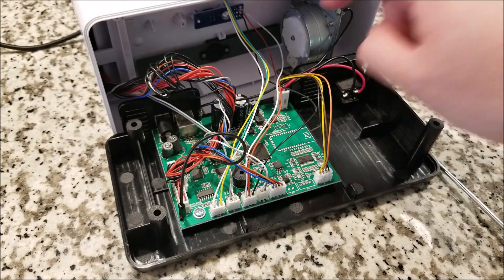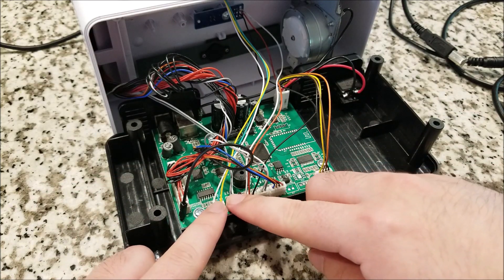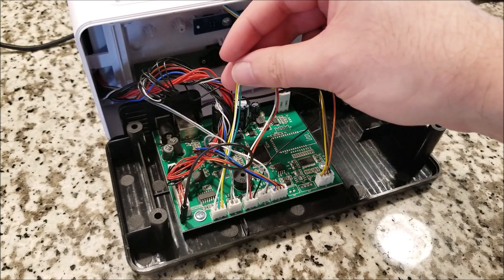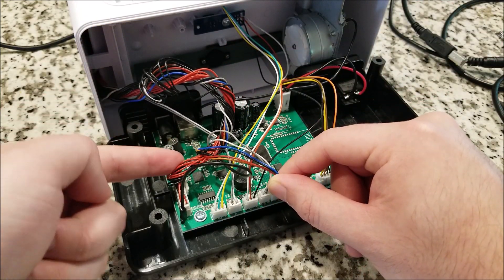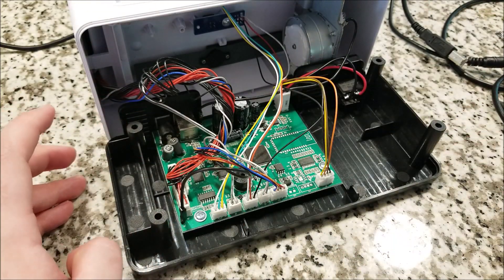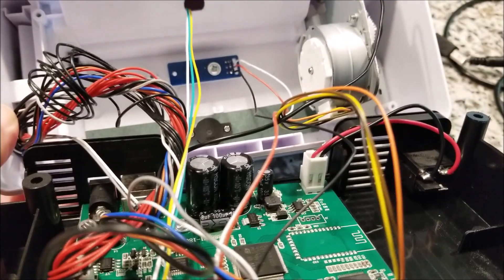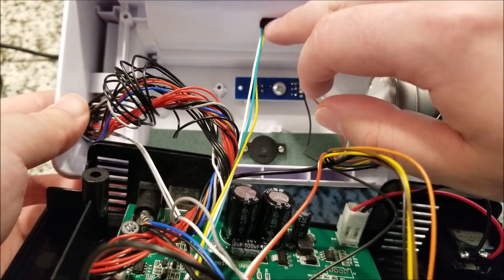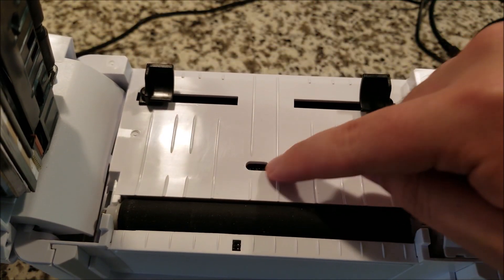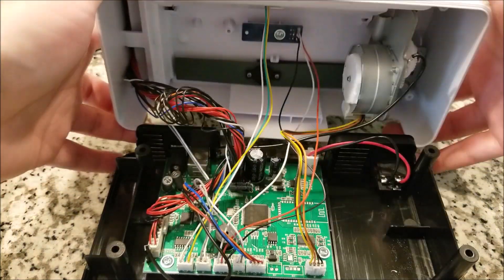There's a motor driver here, and a wire going to what will be a stepper motor. There appears to be a grounding pin as well. These wires go up to the IR sensor in the front that aligns the page. One big bundle of wires goes undoubtedly to the actual thermal head. A couple of other smaller bundles probably go to various sensors and the LED indicator on top. Opening the printer further reveals there's actually another reflective IR sensor as well — they put quite a bit of thought into detecting the paper's position accurately.